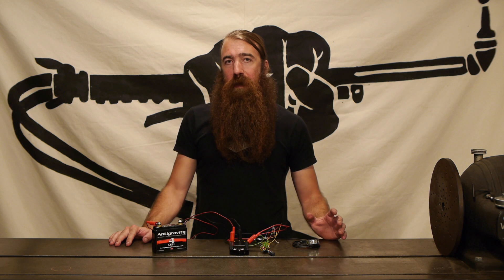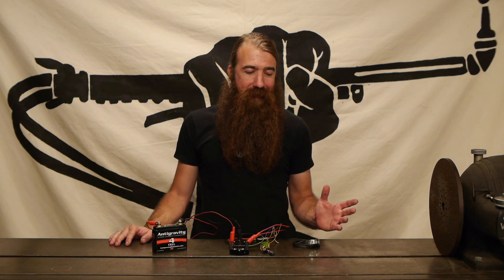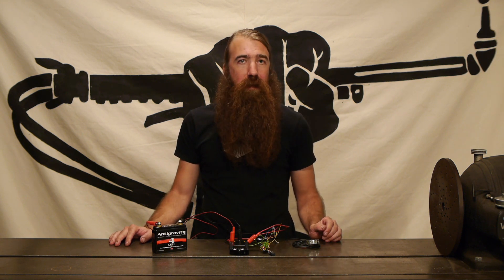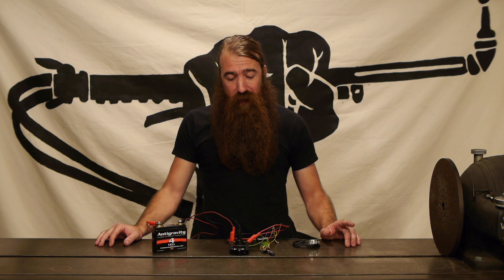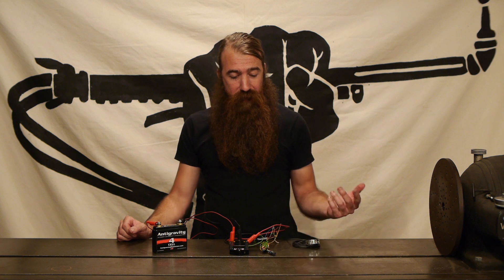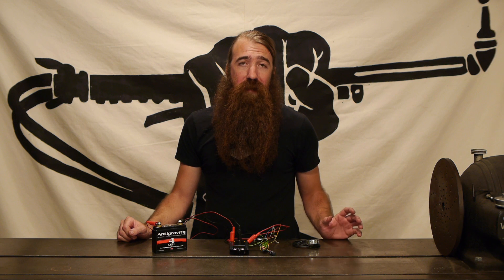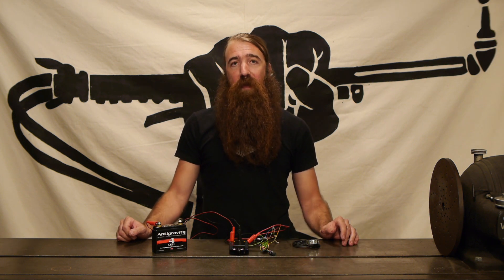We've only seen one case where EMI interference was a possible problem, and even that was suspect. It's not that big of an issue; it's just something to be aware of — you don't want to run this stuff right next to your high tension ignition system. And that's really all there is to say about the MotoGadget M button. It's a really impressive piece of kit and it does simplify wiring from the handlebars to the M unit. I still can't really get my head wrapped around how this thing actually works and is so small, but I just assume it's packed with witchcraft and magic. So thanks for watching — if you've got any questions on your installation give us a call or send us an email. We're always here to help and we can't wait to see your project on the road. Thanks.